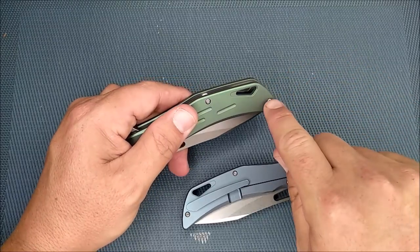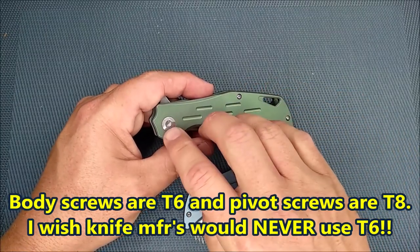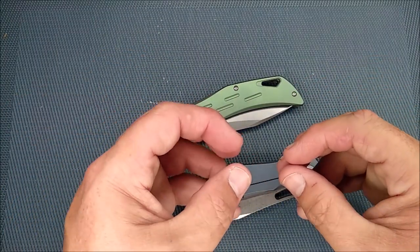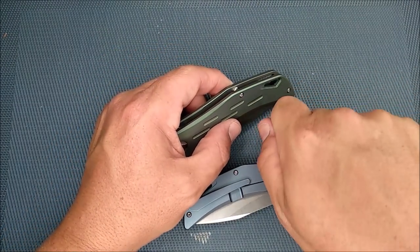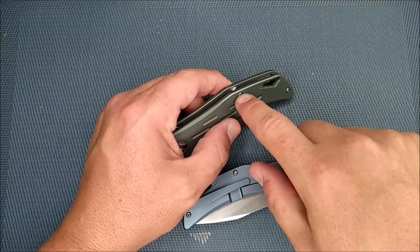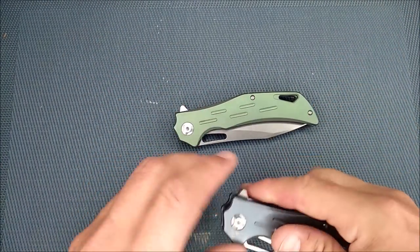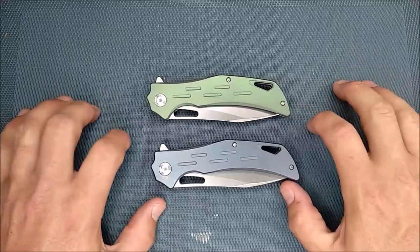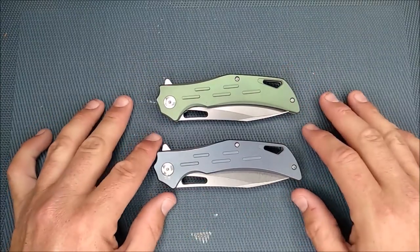So you need to be very, very careful. Get the screwdriver that's the exact right size — I think those are T6 and this is T8. Drive Grip puts a little grit on the end of your screwdriver, helps it grip, and stops the screwdriver from slipping in the screw head. It works with all types of screws. It's very inexpensive in the United States but pretty dear everywhere else — so if you know anybody in the US, get them to buy it and ship it to you.